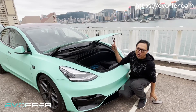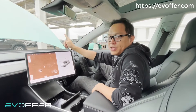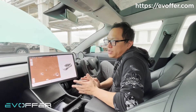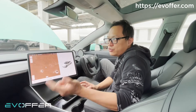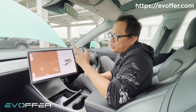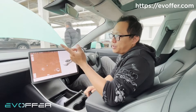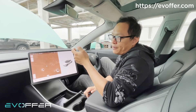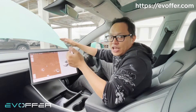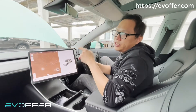Let me walk you to the car to see what happened. You can see that even though the frunk is actually open, the touchscreen shows the frunk as closed. What happened is the system tried to hook the hood in but did not catch the striker. So the car thinks the frunk is closed, but obviously it's not. When you start driving, you won't know the frunk isn't hooked by the latch, and then the hood can fly up. This is a big safety risk.